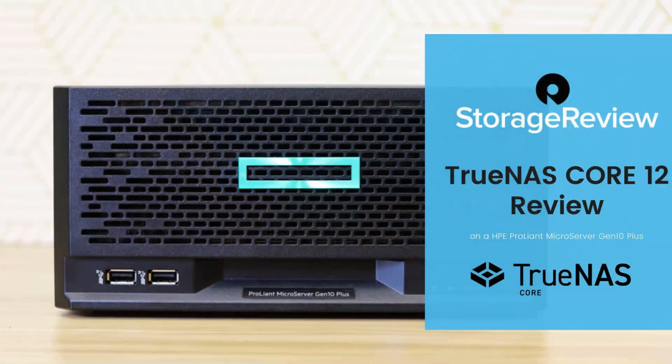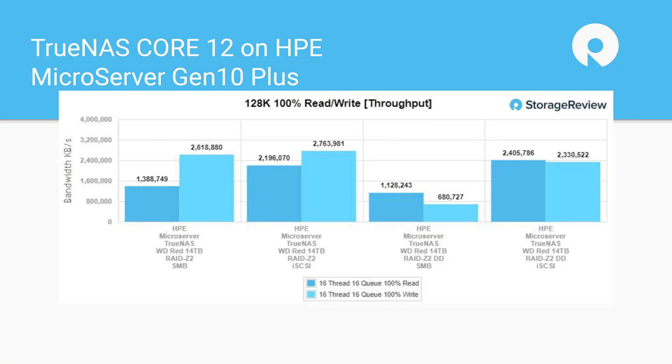Let's look at the performance numbers. Tests are broken into four areas: two for hard drives and two for SSDs — default compression on, and then higher compression with deduplication enabled. On hard drives with iSCSI, we were looking at 2.1 GB/s read and 2.7–2.8 GB/s write. That's remarkable for just spinning drives — it's efficient use of cache. Tests used a 100GB footprint so it wasn't sitting entirely in cache.